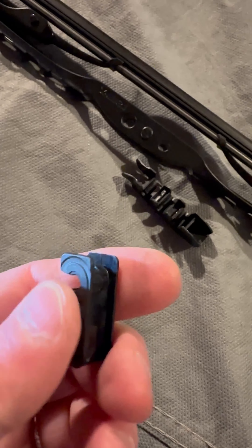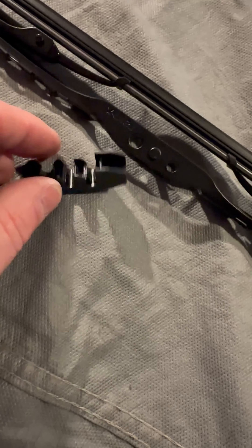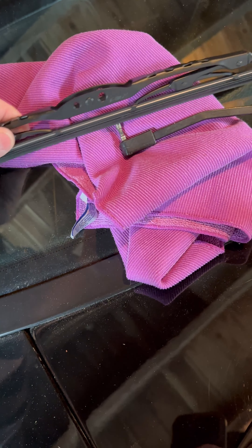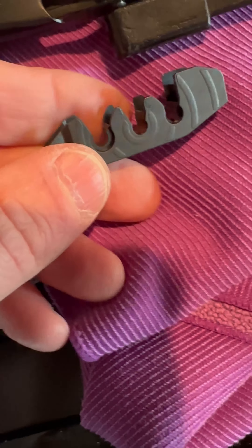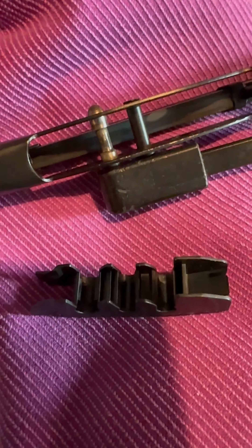This next step — once I took it out of the package, it comes with a couple of different clips, and this is what it looks like. Now remember, I did get the right part number and I did get the right windshield wiper, but I wanted to look again at how this works. In my case I have that pin — there are two pin holes, a large one and a small one — and it has a clip inside here. So what I'm going to do is pop that clip out by pushing on it, then replace it with this other clip. Oftentimes these come with extra clips that aren't used.